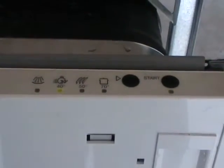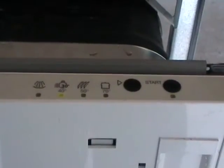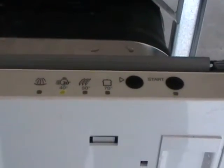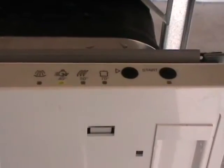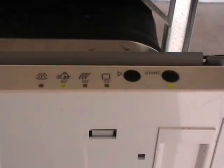This fault is also caused by broken wires in the door. It can be the electronic control, but the first thing to check would be your NTC device. The NTC we've already covered on another video on how to replace it, but this is the failure that you'll see on your dishwasher.